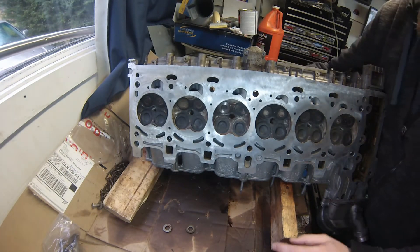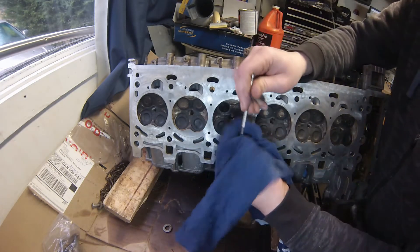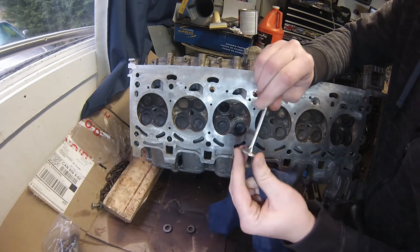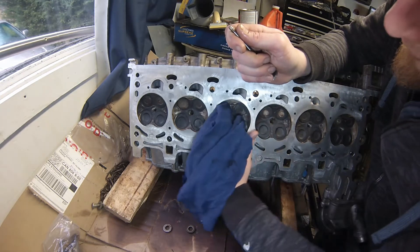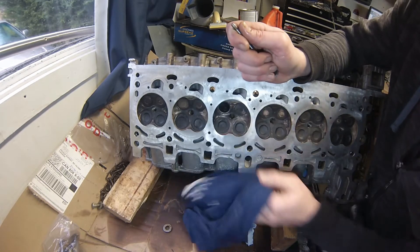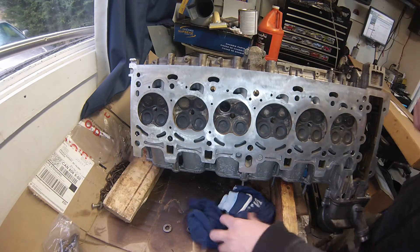The motion you want is to keep tapping that valve in — what that does is recenter all the compound to the middle so that when you start turning it again it grinds in the area you want. Once you start to feel things getting a little smoother it's done something for you. Pull it out, wipe everything off the valve, and you can really see how much we've cleaned up that valve seat. We're going to get a good pairing out of these two just as is.